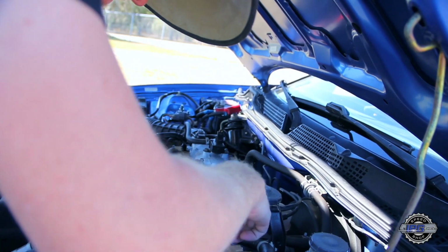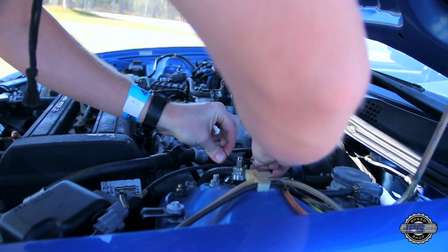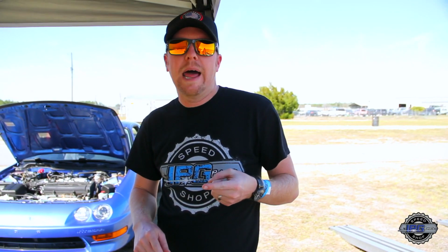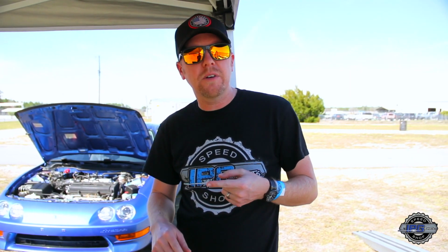After lunch, we came back and we started playing with the Koni adjustments. The easiest things to adjust on these are the rebound. They're on the top of the actual shock itself. So we went out and ran a couple of laps on just making the front a little bit stiffer so we could try to eliminate some of the oversteer that we were seeing. Didn't help a whole lot. The car was more drivable for my style, but we didn't pick up any lap time.